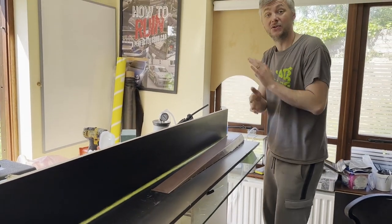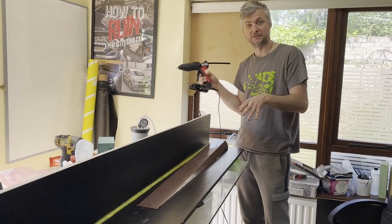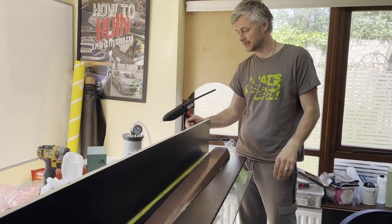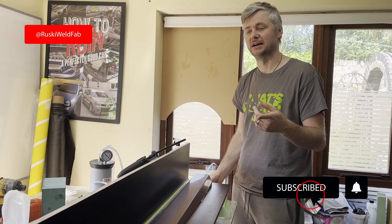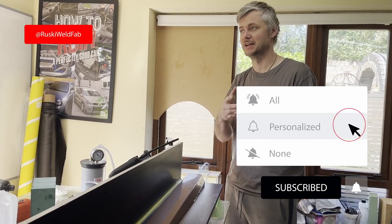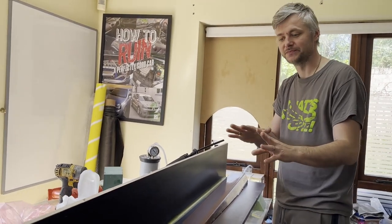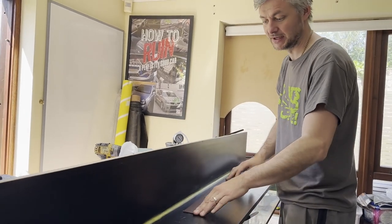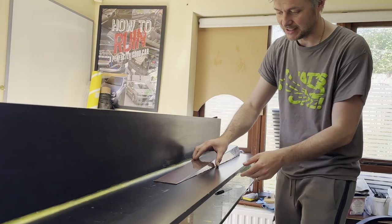That's the beauty about the glue gun. It's so quick, but also when it touches colder surfaces, it sets off really, really quick. So actually it's something to be mindful of. If you're sticking something to really cold stuff, the other stuff needs to be hot because otherwise it sets off too quick. But if it's kind of cool stuff, like a surface of wooden board, it gets cured pretty quick. So that's literally all you need.